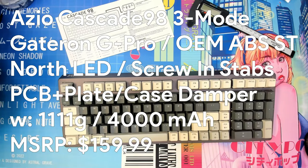Just the specs. Today we took a look at the Azio Cascade 98. It is a 3-mode, 103-key, 98% pre-built. It comes preloaded with ABS shine-through keycaps and your selection of Gateron Pros, either red or brown. The weight of this keyboard is 1,111 grams, while the battery is 4,000 milliamp hours. It does state that it comes with an anodized top plate, but it also states that it can be replaced, but there were no secondary options on the website. It also includes screw-in stabilizers. It does have good dampening with plate and PCB as well as case dampeners, and it is 6-key NKRO. It has 3 device slots for Bluetooth 5 and has standard 2.4 and USB connectivity as well.